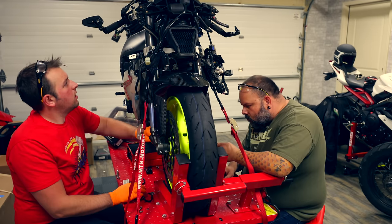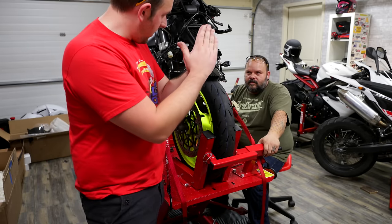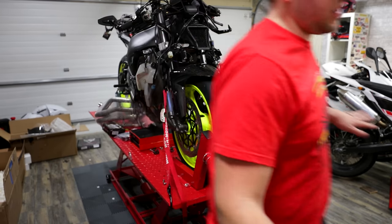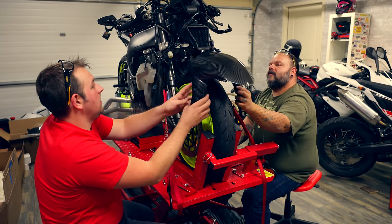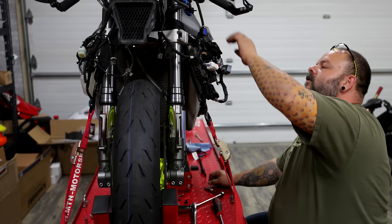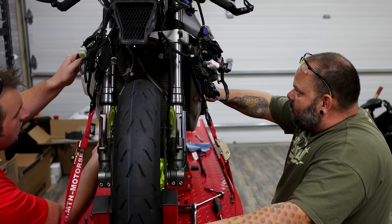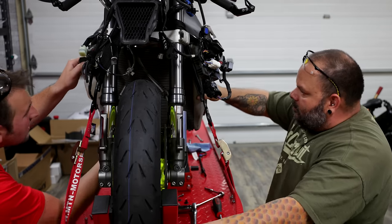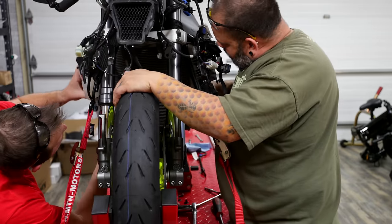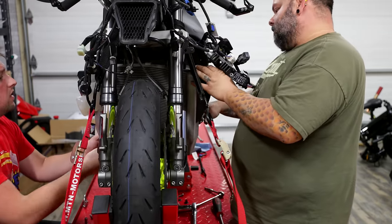All right, dude, so exhaust is getting on. We've got to remove the fender so we're going to pivot the radiator forward. Let it rest against the tire, so we don't want it rubbing on the fender. Yep, of course, because we don't want to mess up our fender. You ready? Sure. So now pull your side of the radiator forward just a little bit and push it towards me. Oh, never mind. It's towards you. There it is. Right. And just let it hang.